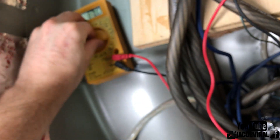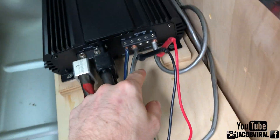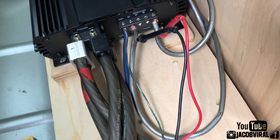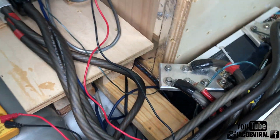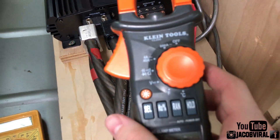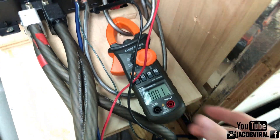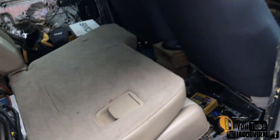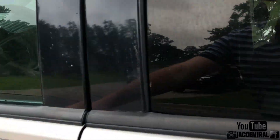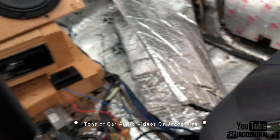What I'm going to be measuring is voltage — the output across the positive and negative. Then with my clamp meter I'm going to be clamping the positive input of my speaker. I'll go turn the vehicle on, get my meter going, and put it on my frequency to find out how my rise is. Let me turn the vehicle on real quick.